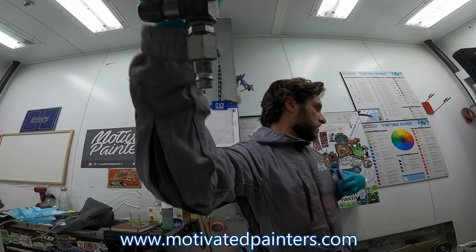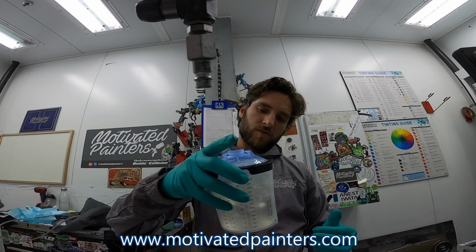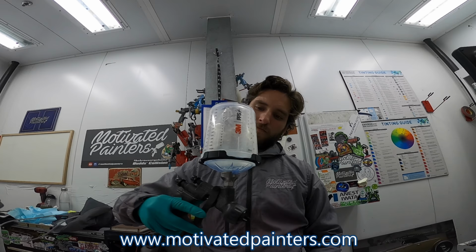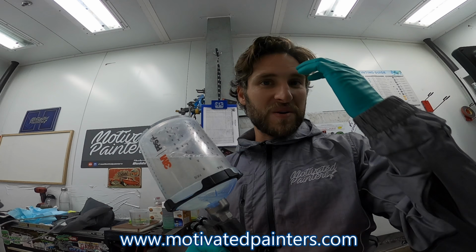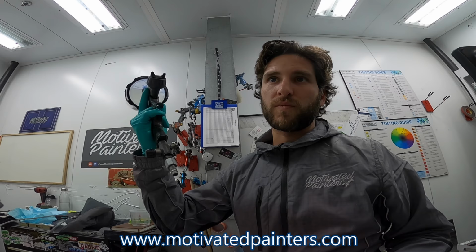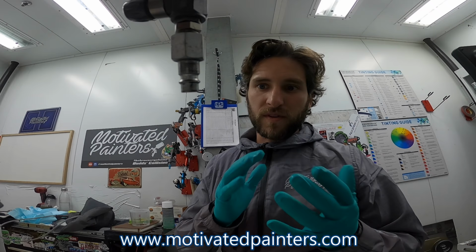I'm spraying with a 1.1. And this, just do a little twirl, and it's good to go. I don't need to shake this clear like crazy or nothing. So I'm ready to go. This is a 1.1. I know 1.1 seems like it's very, very small. It works amazing for me. I love it. Obviously I'm working on Teslas and Range Rovers, and some of those cars have a really nice fine texture, which is almost smooth. So this Welcome 1.1, unreal.